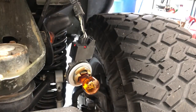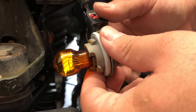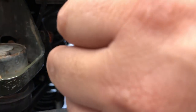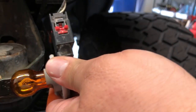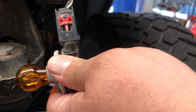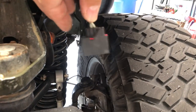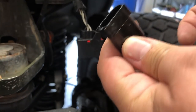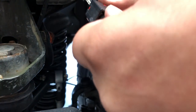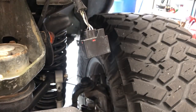Now we can get back to work. Just because it's hard to do this and hold the camera, this is a little bit better. To remove the stock bulb, you would just pull on here — and if you needed to change the bulb, you would change it that way. But we're actually changing this whole unit. What you're going to have to do is there's a little lock switch — slide that up, and there's a tab right here that you press. Once you press that tab, it'll slide right out. The JW Speaker blinkers actually come with a little mounting tab that will pop back in, lock it, and you're all set. Before you do this step, though, you will have to place them into the grill, and I'll show you how to do that now.